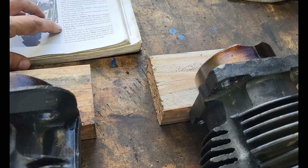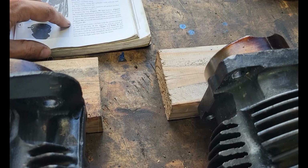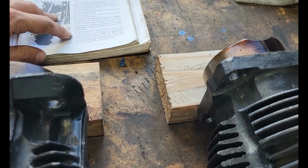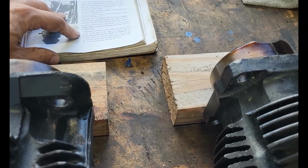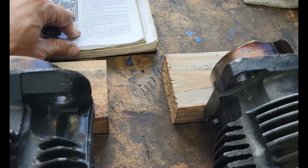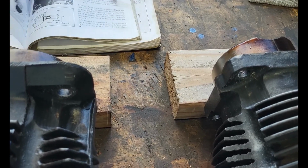Measure the cylinder bores with a cylinder gauge in figure 80 or an inside micrometer at the points shown. Measure on 2 axes, in line with the piston pin and at 90 degrees to the piston pin. If the taper or out of round is greater than the specifications, table 2, table 4, we'll get to that, then the cylinders need to be rebored to the next oversize. So that's what we're going to check.